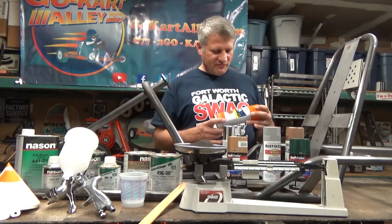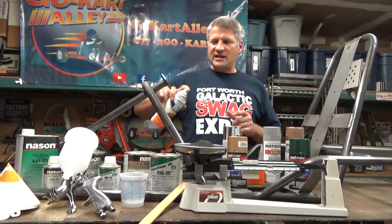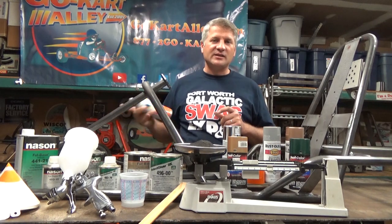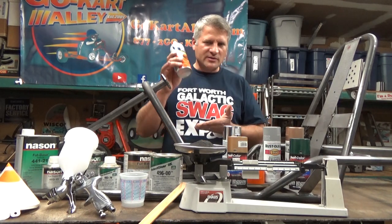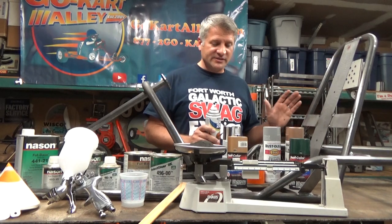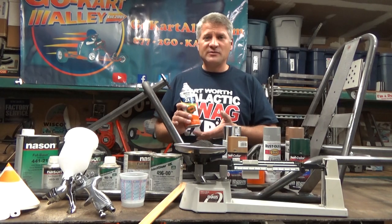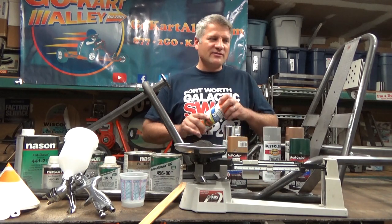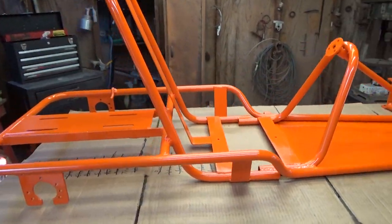As far as the base color, my absolute favorite is Rust-Oleum two times the coverage because it goes on thick. It comes with the easy spray nozzle that sprays at any angle, so when you want to get those hard-to-reach places it gets everywhere — upside down, right side up. Just make sure to keep it shaken up. There are tons of colors available, and they're in ready supply so they'll still be there when you want to do touch-ups later. Rust-Oleum two times coverage with the bare metal frame and no primer — if you want to paint it yourself, want lots of color options, and want it to be as easy as possible, you can't beat it: no setup, no cleanup, no mixing. Just grab it, spray any angle, and do it. With good technique, there's no reason your rattle can paint job can't look just as good as powder coat or automotive paint, which I'll be showing you how to do in our next video.